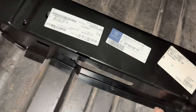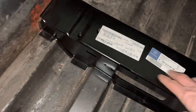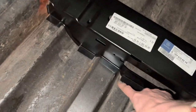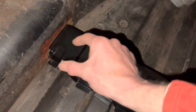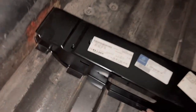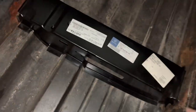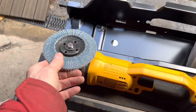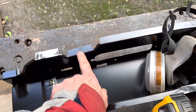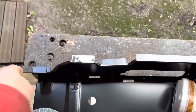The panel bond requires bare metal to bare metal, so we'll take the panel out, sand off all the e-coat, draw around it with a marker pen, sand a bare metal channel, put the glue on, and probably use neodymium magnets to clamp it down. We'll be using an 80 grit flap wheel to take off the e-coat, so we want to be left with shiny bare metal.